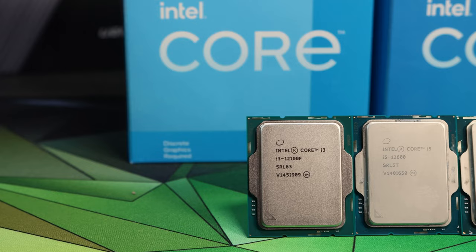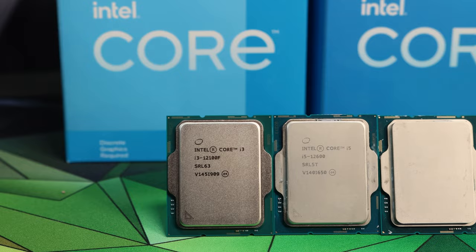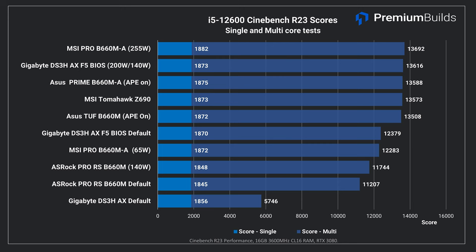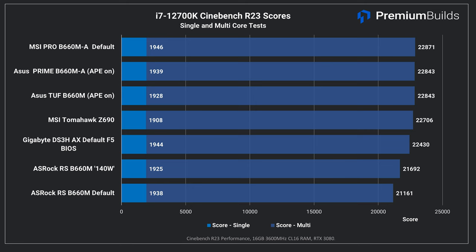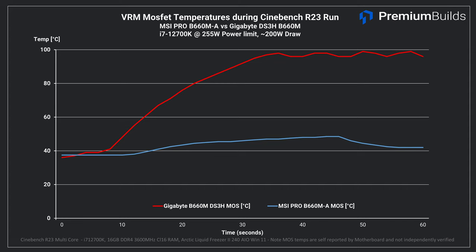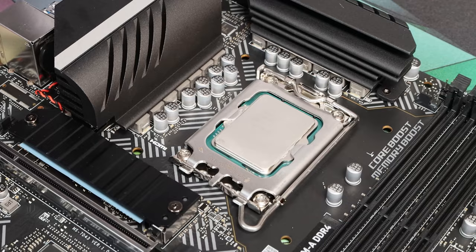As part of our testing we ran an i3, an i5 and an i7-12700K CPU on this motherboard and checked its performance against a range of competitors as well as a control board, the MSI Z690 Tomahawk. It came out on top of our budget B660 motherboard roundup. It ran the i3, i5 and i7 CPUs to full potential, but do be aware that you need to adjust power limits to unlock full sustained performance on the i5 and i7 CPUs — if you do that you should also pair it with an upgraded CPU cooler. It tested well for VRM temperatures under sustained loads. Comparing the Gigabyte DS3H to the MSI B660M-A Pro, the MSI keeps temperatures low not only by having heatsinking across the entirety of the VRM but also because it's a more efficient VRM, not being stressed to the same degree in delivering the 200 watts required of it.